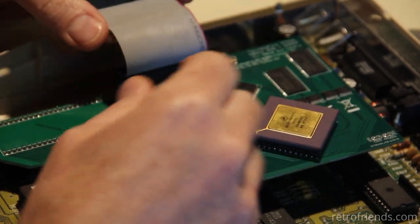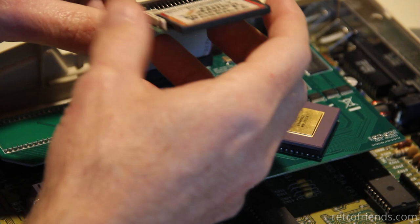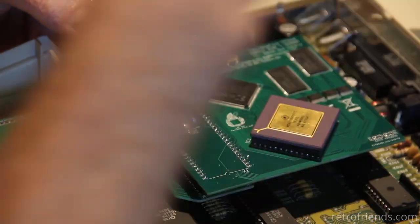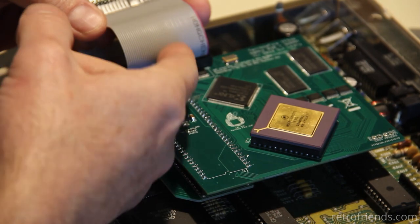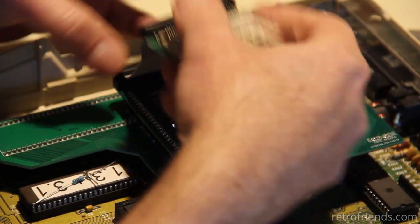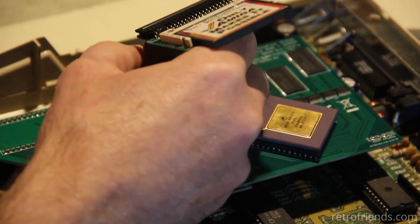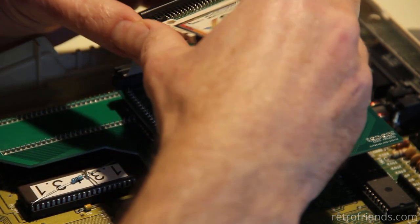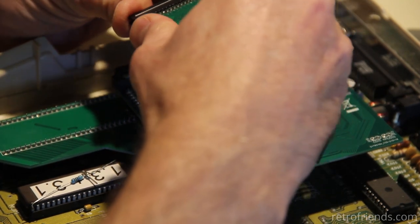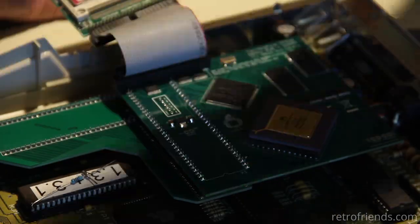I fit it into here based upon the notch of the cable. The socket here for this ribbon cable has an empty notch — it's an actual socket with a plastic rim around it with a cutaway. There's only one way that ribbon cable will go in there. Does it tell me where pin one is here? I guess I can try reversing this. Pretty sure I've reversed IDE cables before without incident. Let's try.